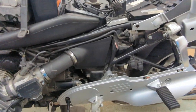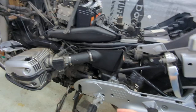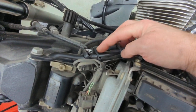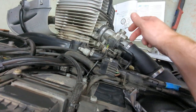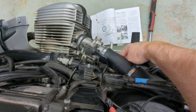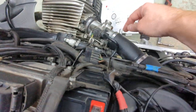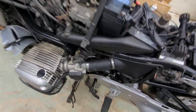I had to drop the exhaust completely. One tip: this is the O2 sensor connection — if you just cut two zip ties and follow the wire, there's a little clip on the side of the transmission you can pop off. That lets you slide the whole wiring harness down far enough to swing the exhaust out without removing the O2 sensor entirely. That's a handy little tip.